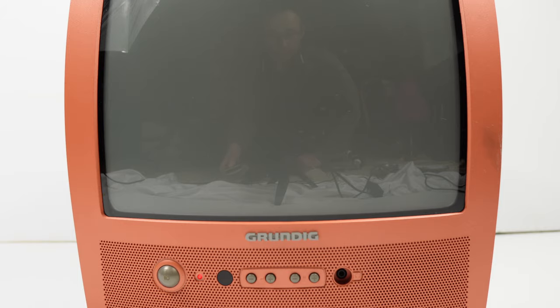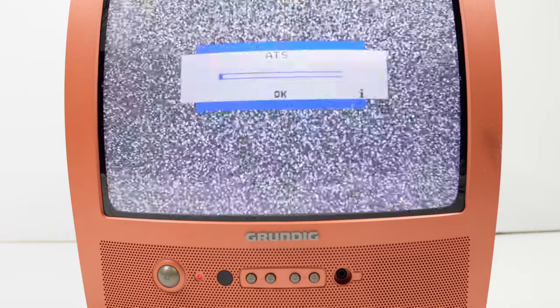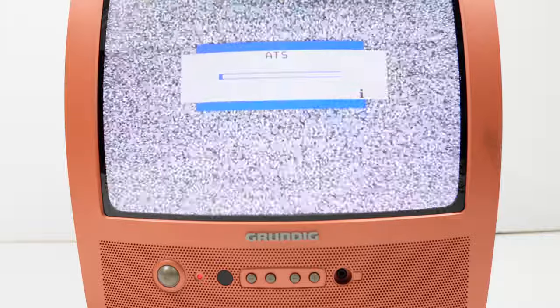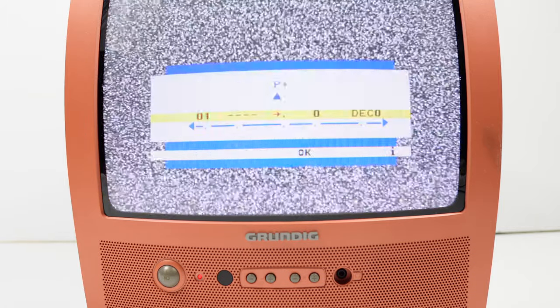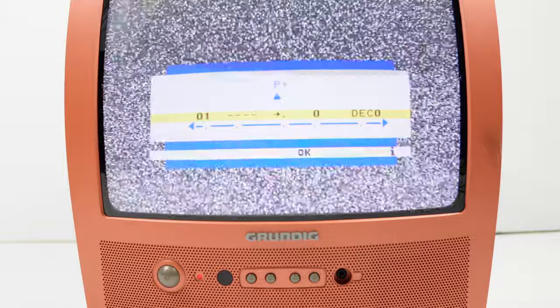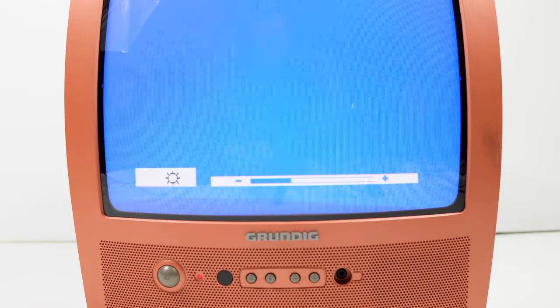To tune in channels is a little bit cryptic, so I figured it should be good to mention here. Hold down the AUX button for four seconds and that comes up. Press OK and the television will start to tune channels in automatically — the old analogue signal. As for the TV's own menu system, it's very, very basic. Press I and OK. It almost looks like a cryptic service menu display. You can tune in channels, maybe name them. Very, very basic — I don't even see a contrast or brightness adjustment; those are done on the remote with purpose-made buttons.